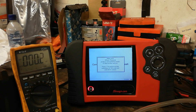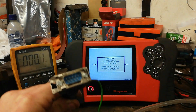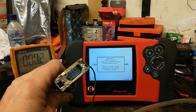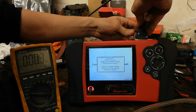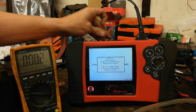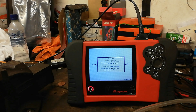So what I came up with is this - a connector with a nine-pin jobby. We have a red and a black on pin one and pin five, and that's our signal out with a 4mm banana on it. We connect this into here and the signal wire goes to channel one.